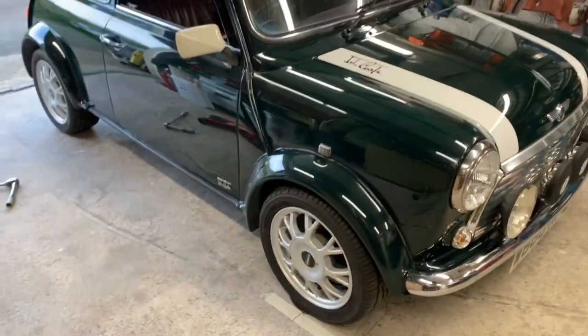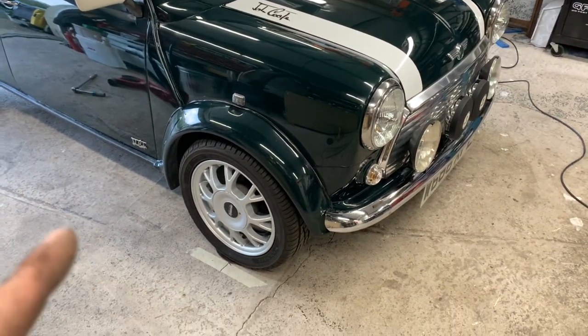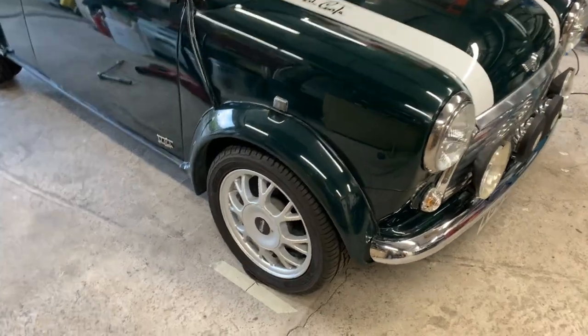You can see just how much work goes into messing around with mini suspension. Now we've got five and a half degrees caster, 0.5 degrees camber, and about 20 minutes toe-out on the front, and near enough dead square on the rear with no camber. Hopefully now she'll drive nice again - she should drive better than she did before. Considering this car was doing 70 on the motorway, 100 easy as pie, she used to drive really sweet. That's about it for now - that suspension bit took up quite a bit of time. I'll take you out for a drive when I get it back. Thanks for watching, see you in the next one.